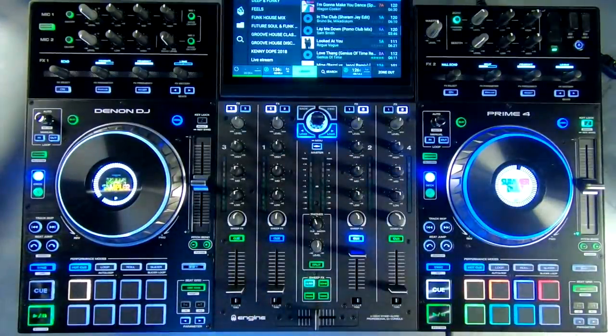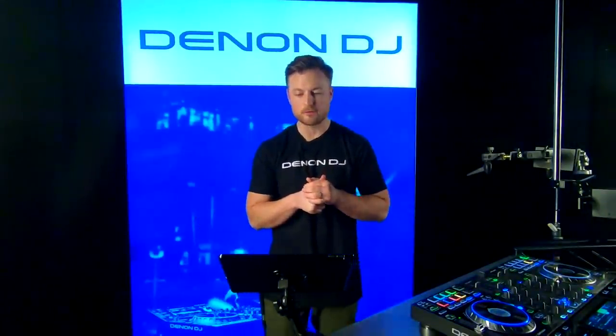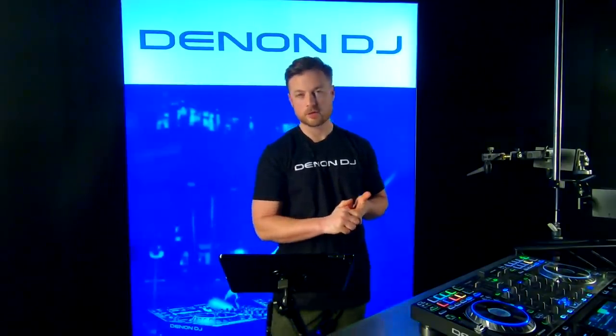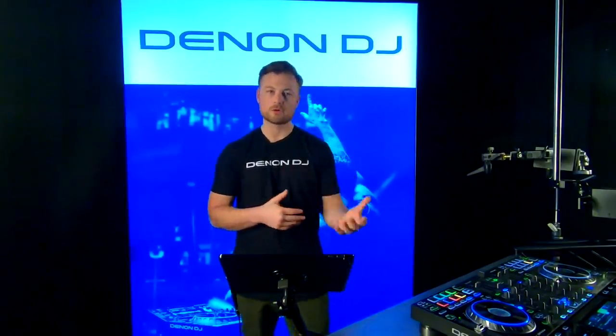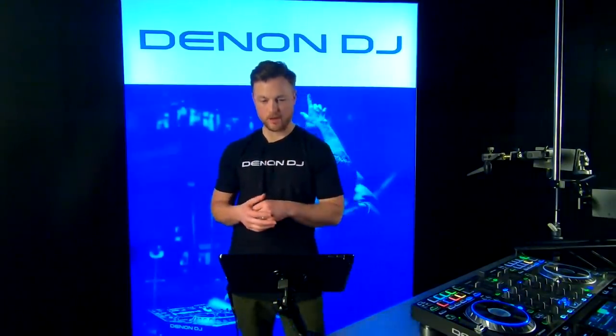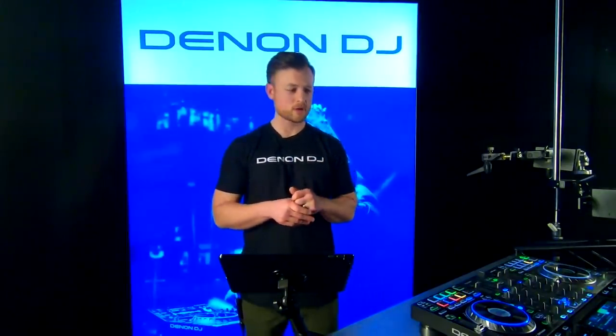All right, so we've got two more questions coming in. What is the preference on type of internal hard drive? I would suggest a SATA drive, obviously an SSD. It's a 2.5-inch SATA drive, so make sure you get an SSD. It's going to give you the fastest response when you're searching for things, making sure that you can hold all your music and all your search results are going to come up very fast. So definitely get your hands on a solid state drive. They're not that expensive these days.